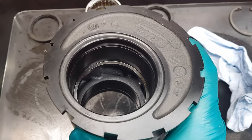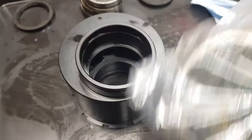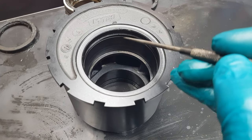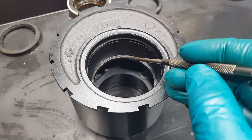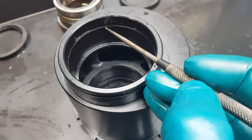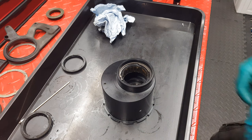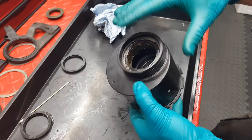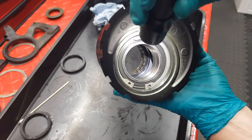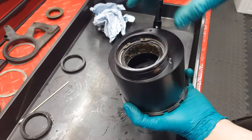The hub housing has had a good clean, getting all the grease and crap out. Start with the needle bearing side and press that one in first — here's the new one ready to go in. Press the bearings all the way in so they seat on this lip on both sides — they should sit flush with the groove ready for the lock ring. I've pressed in the bearings all the way to the end, you can see them right at the bottom.